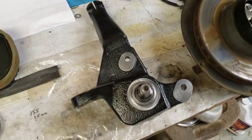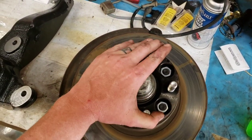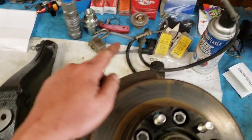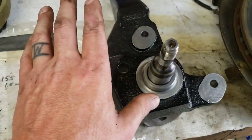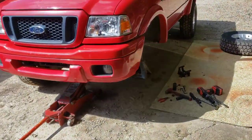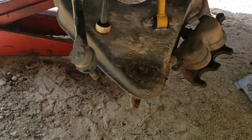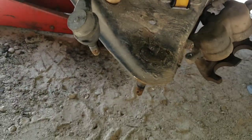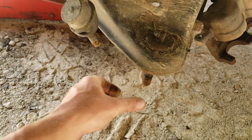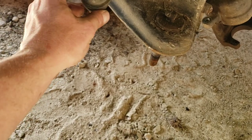These are four-inch lift spindles and I've got the old one off the truck. I gotta swap over the rotor, the brakes, the wheel speed sensor, and maybe the dust shield if it'll fit. They come apart pretty easy — I got the truck on jack stands and just took it apart. Upper ball joint came out pretty good since they haven't been in there very long, bottom one wasn't too terrible. I do have to put a tie rod end on it — the boot's been busted for a while.